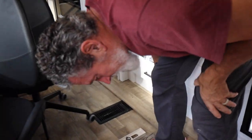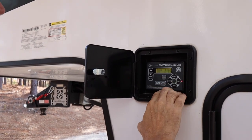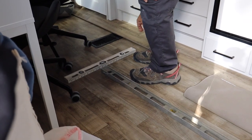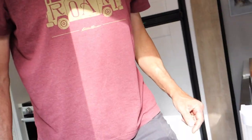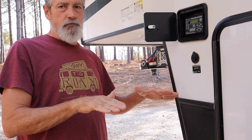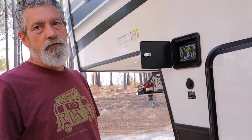We don't want the tires to be off the ground because that helps with stabilizing when you're walking around inside. One mistake a lot of us make is we keep raising one side up, and that indeed will put the tires up. So you can raise one side or lower the other and it kind of does the same thing. We still need to go some more — so I was lowering that side and it told me you can't go any farther. So we have to go back to the left side, bringing it up a little bit more. It's sitting on such an unlevel spot that it automatically tells us if we're starting to twist the frame. This is really hard to do on an uneven surface.